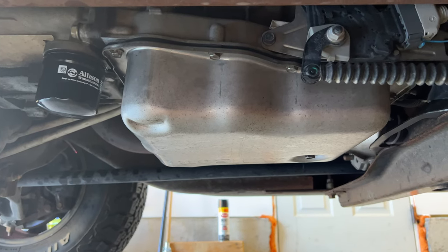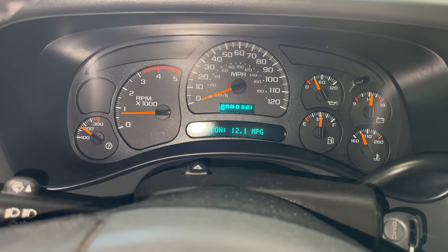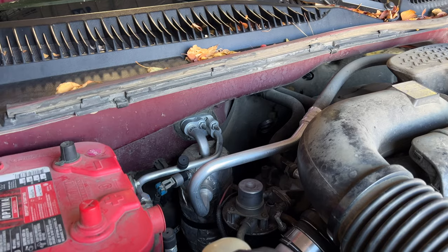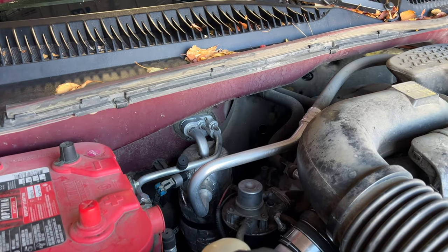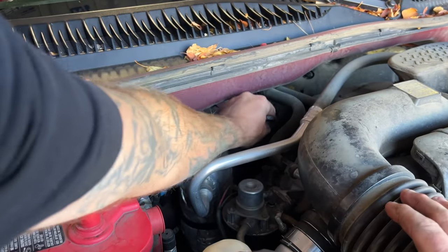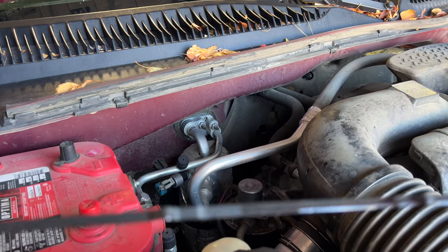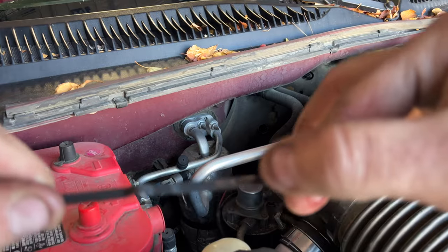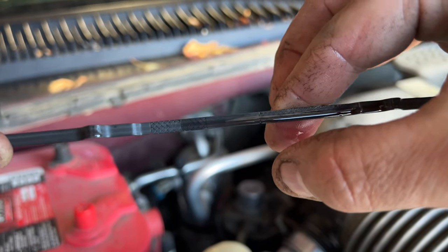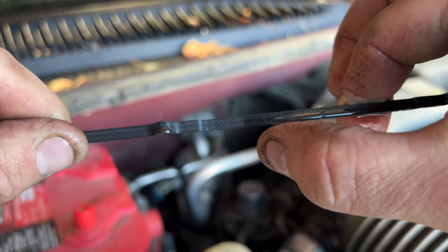I just got back from a drive. It took a while to get it up to temp, but you can see in the bottom left the transmission is at normal operating temperature. Let's go ahead and check the level now — pull your dipstick out, wipe it off, stick it back in, pull it out. We are right in the middle of the hot crosshairs. I'm going to call that good — that way if it warms up a little more, it still has room to climb to the top of the hot crosshairs. As long as you're in the hot crosshairs, you should be good.